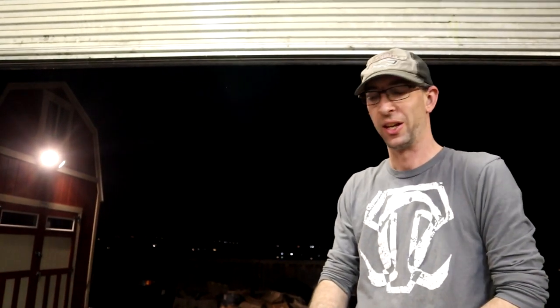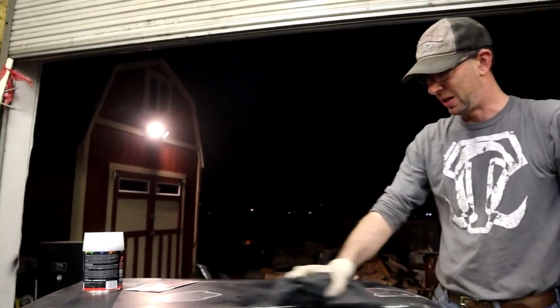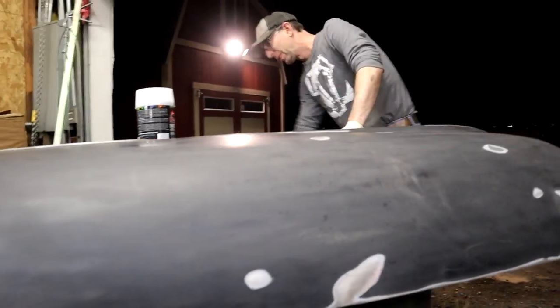Because we're using Raptor liner on it, we don't have to fix every single imperfection, because it's a thicker paint. On regular body paint, you want to. We're going to do three coats on everything. Well, it's 2 coats and then kind of a dusting coat. You do it from further away just to add a more thick texture to it after it's slightly dried.